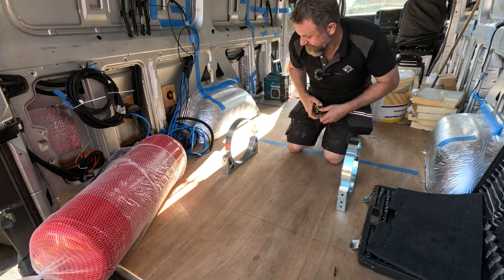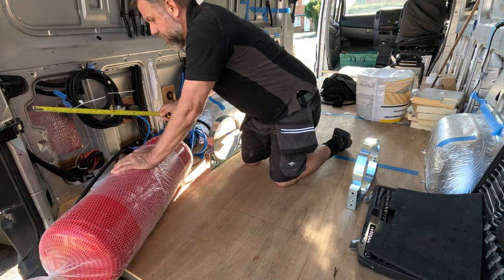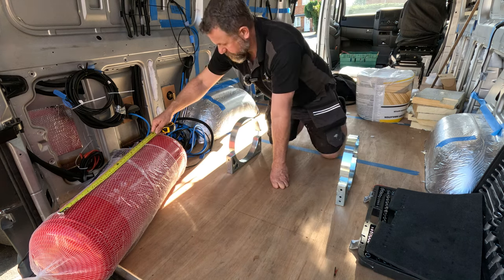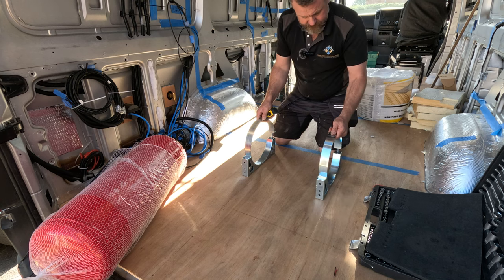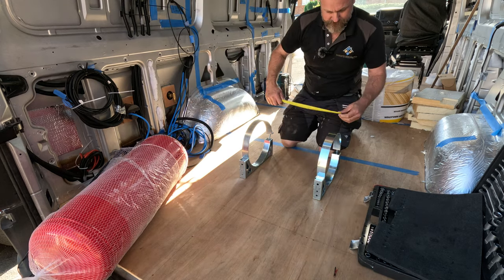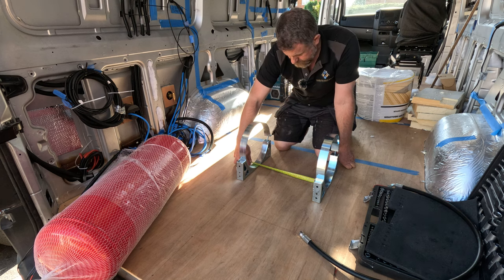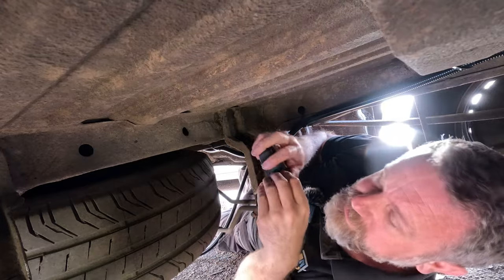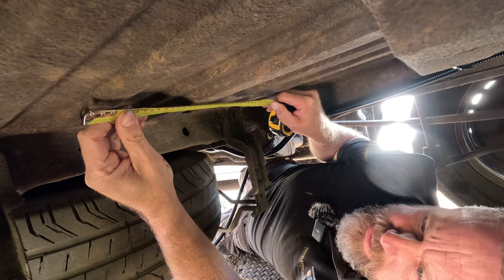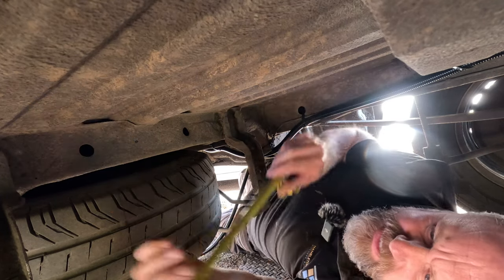There's my axle beam roughly here. I want to be roughly 45 centimetres apart - 60 is far too much, so if I bring them just inside of that, that's just about acceptable. 38 centimetres in between them - but is that going to correspond to the bumps underneath? Let's find out. Oh this is fun under here, I love being under the van. I can see all the bumps and ridges - 38 will work. I should have brought a pencil.